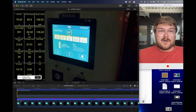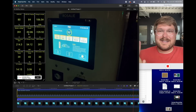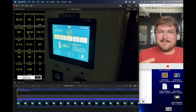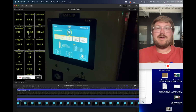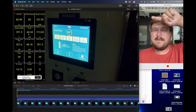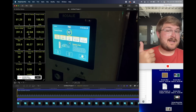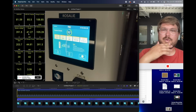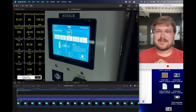The one thing I didn't record here is the 90 to 100% state of charge. And that's because I'm an idiot. In the truck, again, this is the first day that I had it, and I actually knew about this, but I couldn't get it to really work. There is a one-time max charging limit menu. So what you do is you hit the Ford F-150 Lightning in the top left of your user interface screen. You then go to Settings, Charge, and then inside of that charge menu, by the way, is the only place you can see your state of charge unless you're on the comm screen or you're on Blue Cruise, hands-free Blue Cruise. That's a big miss. It should always show your state of charge on the screen somewhere.